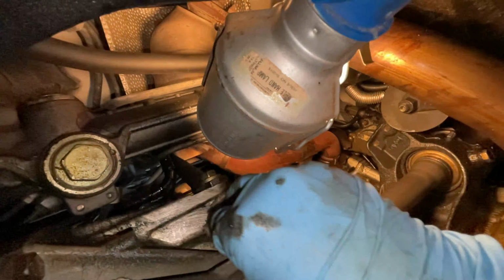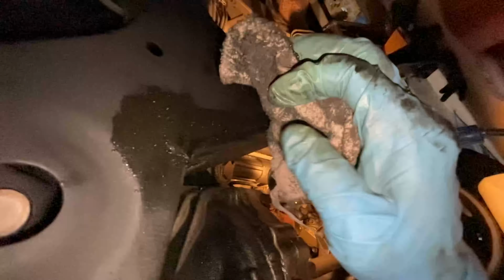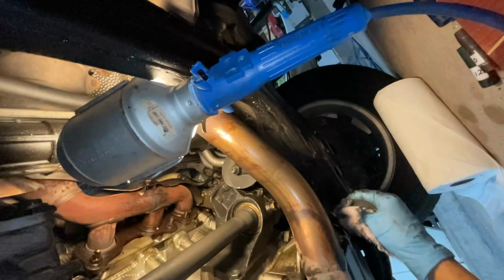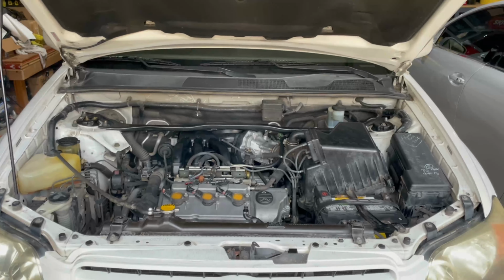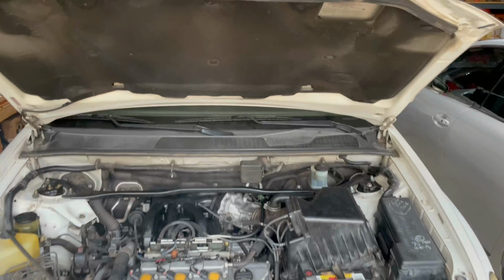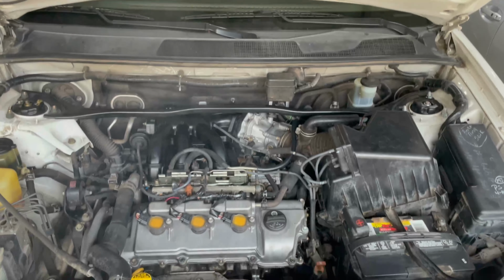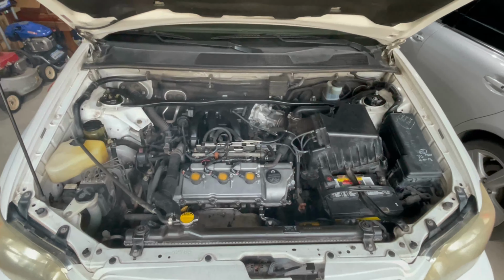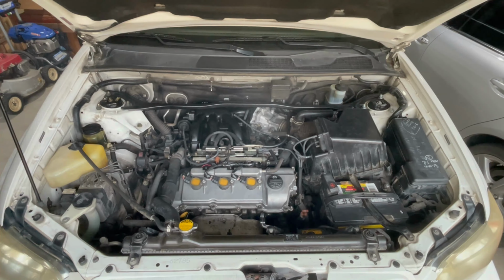Though I'm gonna speed through this boring and laborious work, it took me several hours, which includes another phase of multiple soaking and cleaning with engine degreaser spray after everything was installed back. If you don't do this, the hot engine will generate smoke and an oil burning smell will come through to inside the cabin when you drive the car. Worse yet, the next buyer or mechanic will suspect that you have an oil leak, or you won't be able to easily find the next new fresh oil leak.